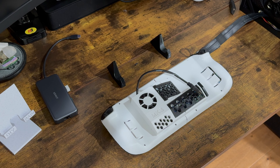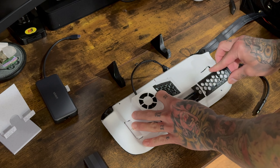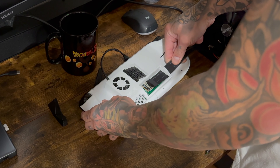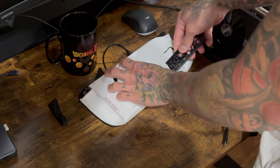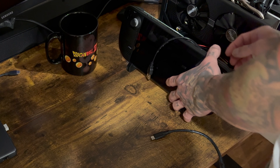With the Mark 8 backplate it's a pretty simple setup. All we gotta do is pull out our cover plate for our SSD, then after removing the SSD go ahead and plug the M.2 to PCI-X16 adapter to the port. Place our foam down for our compression fit, slide in the cover plate, and place the Steam Deck on our custom built stand.